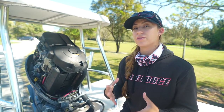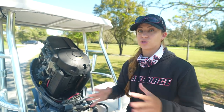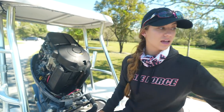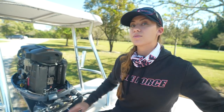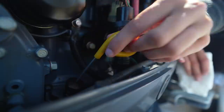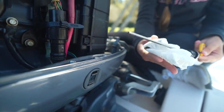Some manufacturers might want the engine warm, some cold, some might want you to tilt it up for five minutes and then bring it down. Check with your manufacturer. We've had our engine tilted up for five minutes based on what our engine requires, then trimmed it all the way down so the oil can drip down into the crankcase. This yellow tab right here is our dipstick — go ahead and carefully pull this out and take a clean paper towel and wipe it off.